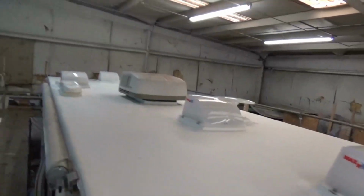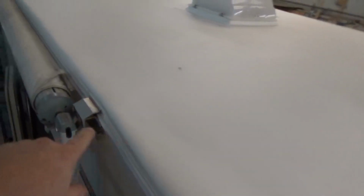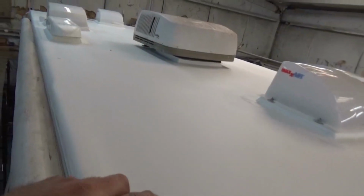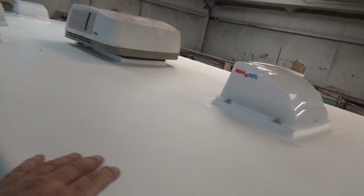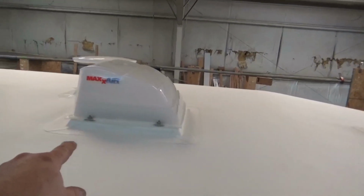Well, this is us. Got all our curbs in. Everything heat welded. Got 2 layers on here. 60 mil is the thickness of this roof. It's a 60 mil TPO, thermoplastic. Make these special curbs up. You can see we heat weld. All of that is all heat welded. That's a 3-inch flange on there. We heat weld all of that together.